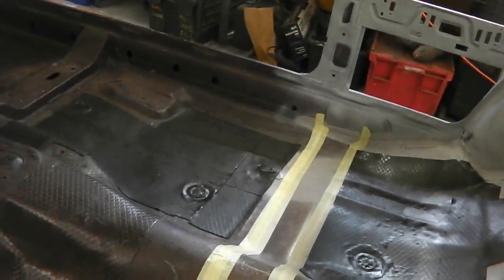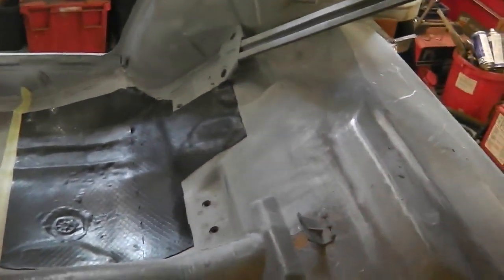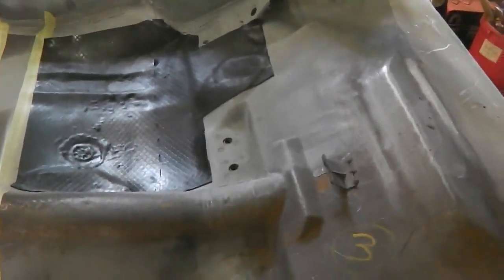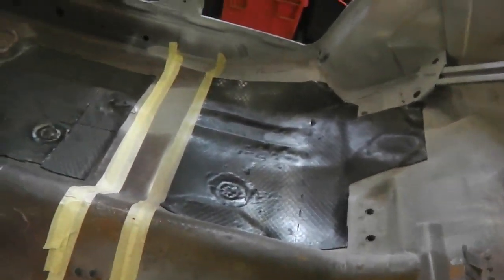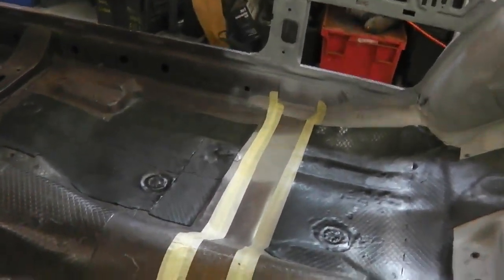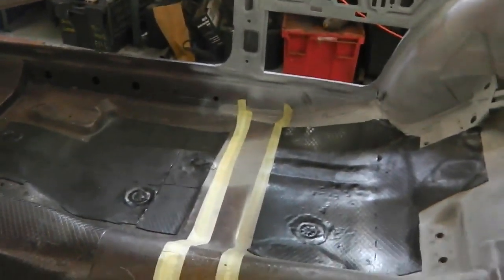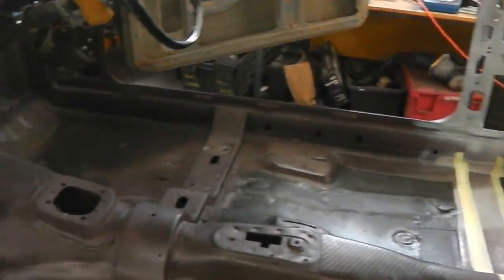Not an exact copy of how Ford laid them round. It's just because the size of the squares, it has cut the nearest corners out. So you're meant to leave those seatbelt mounting anchor points free. And then basically cover as big a floor area as you can. They're not so much for soundproofing. They're for sound deadening. They stop the drumming of the panels. It just gives everything a more solid feel. Sound deadening is a separate mission with Dynamat cut exactly to the floor pan sizes.